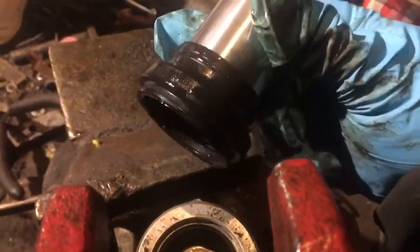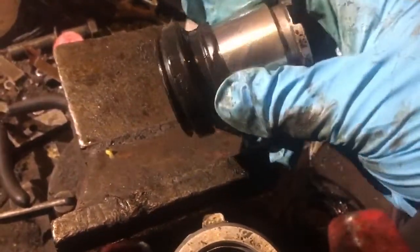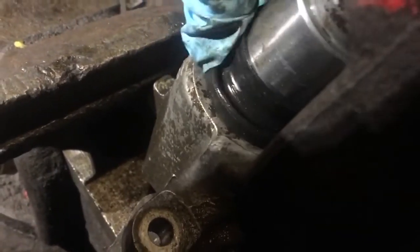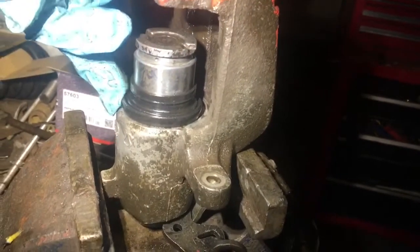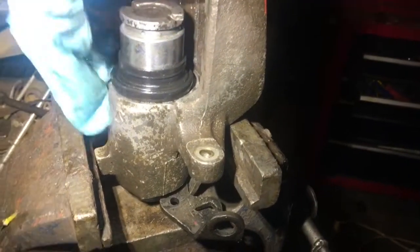Now that it's all set up, a little bit of brake fluid again just on the cylinder to help it slide. Now we have the boot and we're going to try and set it into the little gap just in here. It's probably the most difficult part of the operation to line the boot up. Okay, that seems to be seated quite nicely. We have the boot seated, the piston sitting on top, and it's sitting on top of the spiral, so it now needs to be wound down onto the spiral and obviously will be inside the piston.